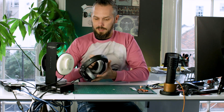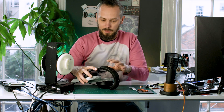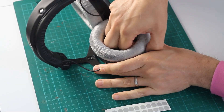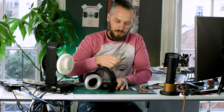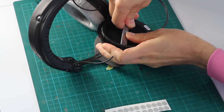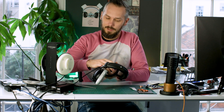Let's do the left ear cup. These have been designed so you don't need any special tools to fit them — it's a relatively easy, straightforward job for anyone to do in about 10 minutes. What we're going to do is extend the arms out fully on the DT770, hook one arm over the other just to keep that ear cup out of the way. Then we're going to remove the pad. Then we remove the retaining ring — for that you'll need something blunt and thin; I recommend a butter knife, I'm using the handle of a scalpel. Stick it up underneath the ring between the foam pad and the retaining ring, give it a twist and there'll be a pop. That will pop out. Now under here, as you can see, here's the actual driver — that's the bit you've got to be careful of.